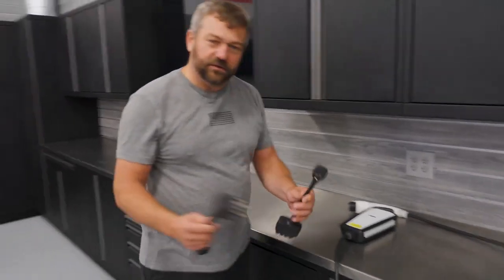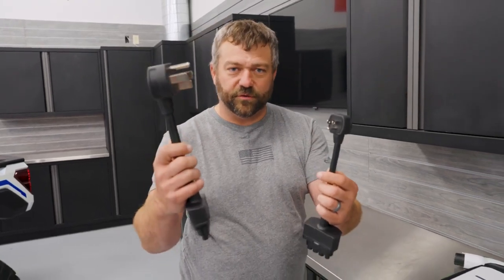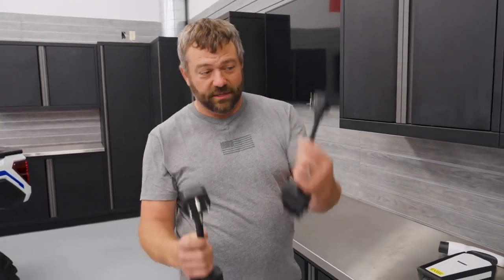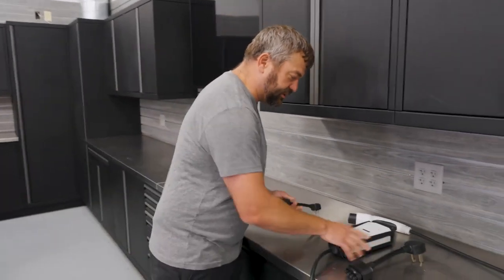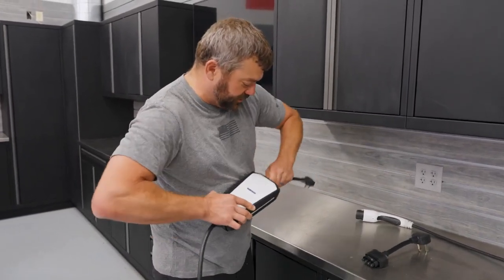Come on back and follow me to the wall so we can see where power starts getting into this Ranger. When you get a new vehicle, you actually get two of these adapters — one for 110, one for a 220/240 outlet depending on what you got in your shop. Today we're going to be using the little guy so we'll get a slower charge rate, but it'll at least demonstrate since we're too far from the other outlet here.